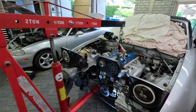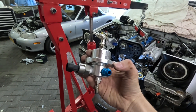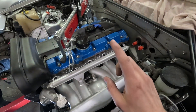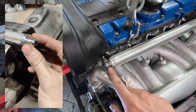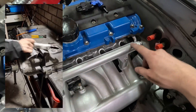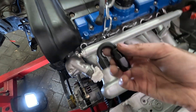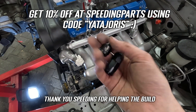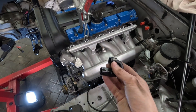Welcome back to the MX-5 5-cylinder build. Today we're installing the fuel pressure regulator and getting the fuel system ready for this car. We've got a bunch of AN lines and if you've been watching this build since the Instagram reels, you would have seen that I welded AN6 bungs onto the stock fuel rail and we've already got 550cc injectors in there. Today we're using a bunch of Speedflow AN fittings combined to make this fuel system ready, looking neat, tidy, and reliable.